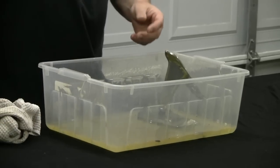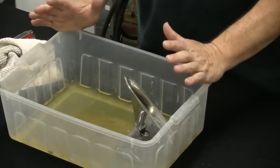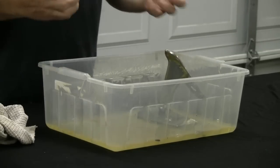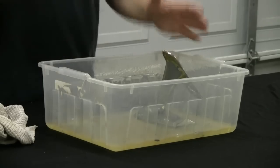What I've got here is basically a flat blade screwdriver and a rag. What I want to talk about first is how to separate the glass from the actual mirror itself. Some guys have recommended lacquer thinner, but I actually prefer gasoline or diesel fuel. Lacquer thinner will evaporate much quicker than gasoline or diesel, but all three of them will serve to loosen the glue on the face of the mirror. When you do this, set it in a pail and put it outside overnight — you don't want this stuff sitting inside your shop. Gasoline vapor is far more volatile and far more problematic than gasoline itself.